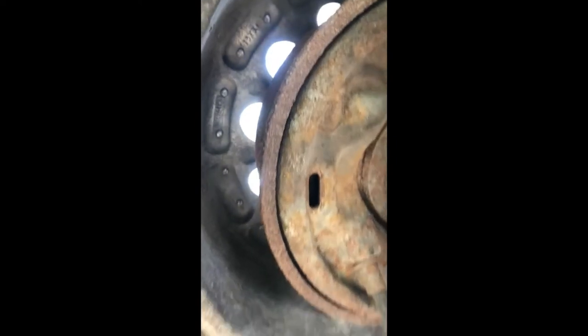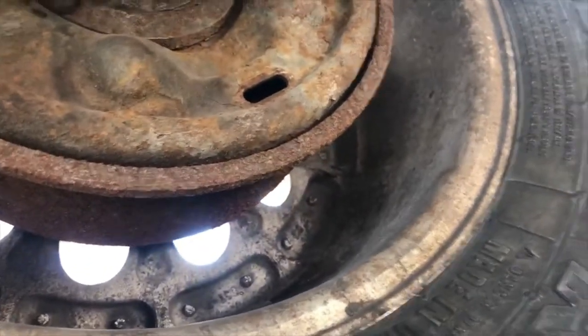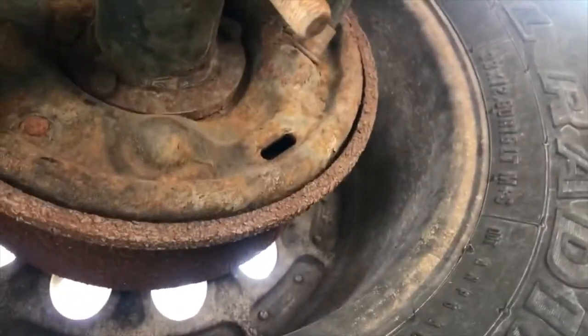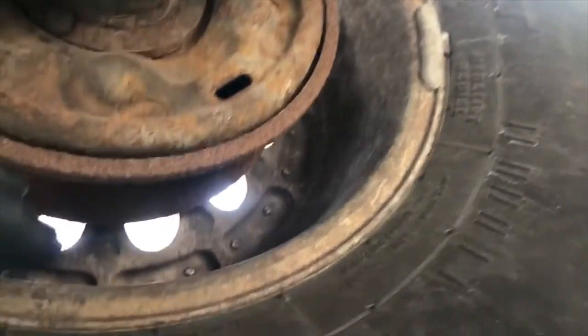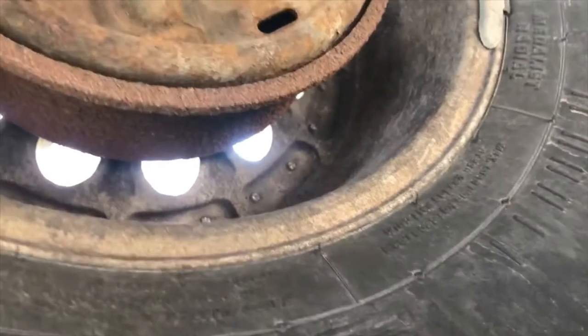It's dragging a little more so hopefully we're going the right way. I was going the right direction - sticking it in and prying down, which turns the wheel inwards towards the center of the vehicle to tighten it up. Using the wheel weight as a marker, give it a spin - about a rotation and a half, that's pretty good. Drum brakes self-clearance so you don't want them super tight or you're just wasting brakes. Keep count of how many times you lever on it, because you want to make sure both sides are even.